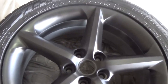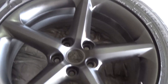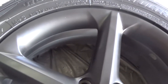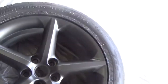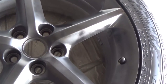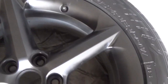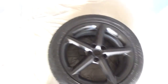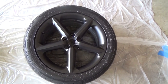This is what we got with three coats on it so far and it is looking nice. I think the key is those wet coats towards the end just to make sure it's a nice smooth finish. Probably going to do one or two more coats - I'll just go ahead and use up all the Plasti Dip. After that I'm going to add the glossifier as well. So far I like it a lot. I think it's going to look really cool with the black wheels, silver Sky, and red calipers.